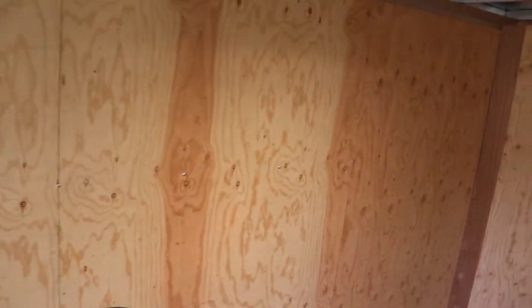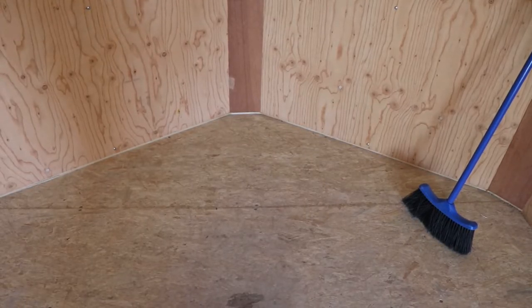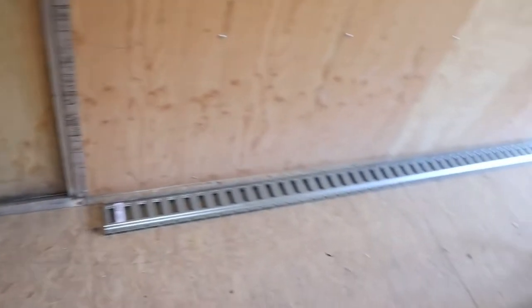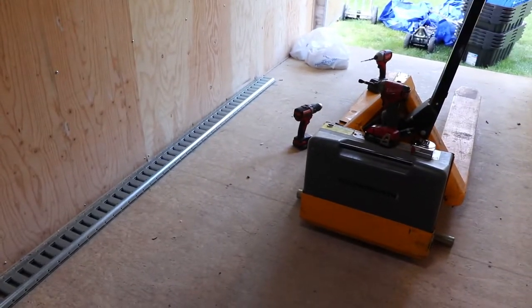I'll see if I can figure it out for the next piece here. Then I'm going to be putting another track on here — I can't start in the corner, so I'm going to start at the first stud past the corner, so I'll be back about eight inches and go as far as I can there. They always say to load the trailer as much as you can forward, but I found that I ended up with a bit too much tongue weight if I use the front piece of the trailer. So I'm going to try to manage things so I don't overload the vehicle — with the van I probably had a thousand pounds extra weight on the rear axle, lifting up the front axle by 500 pounds roughly. I'll put on the rest of the track and we'll take a look at how it looks after that.